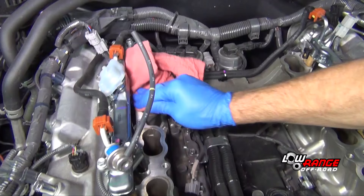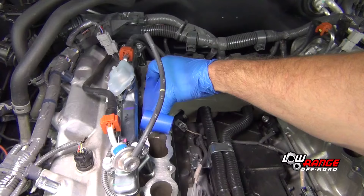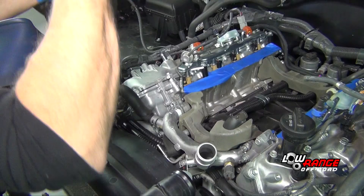Take special care of these intake manifold gaskets — they'll be needed with the supplied supercharger. Clean off the gasket surface with brake cleaner and a cloth. Cover the intake ports with masking tape so that things don't accidentally fall into the engine.